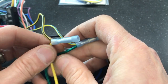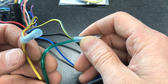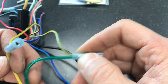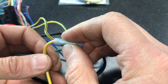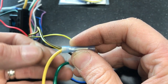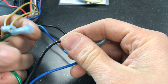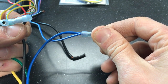These are the two wires people tend to have confusion with. The green wire is always the parking brake wire — it sends a solid ground output, and that's going to be the yellow-blue wire on Alpine head units. The yellow wire is the foot brake, which sends out a 12-volt pulsed signal, and that's the yellow-black wire on Alpines. So: yellow to yellow-black, green to yellow-blue, black to ground, and blue to remote — that's what tells it to turn on when it needs to.